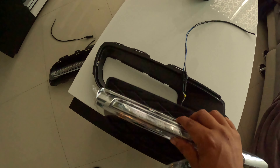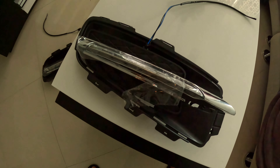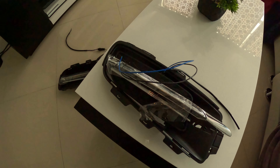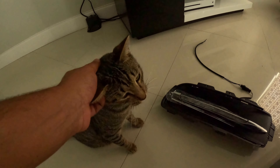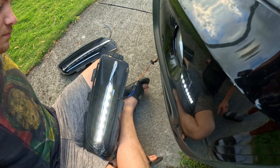What's good YouTube, RNR Motorsports back with another one. Today we're going to be installing these LED daytime running lights on my E70 X5. I already have the housings pulled off the car and the OEM slots taken out. What I sell on my website are these LEDs - once you pull out the housing from your bumper, it just clips in right here. There are clips all around and it's two wires: blue and black.